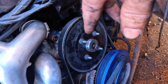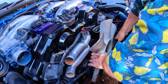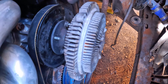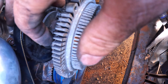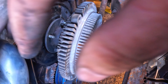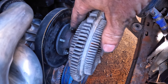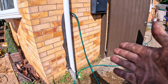Now I'll loosen up these 10mm bolts and refit the viscous fan. The best way to do this is with the fan off the pulley initially, because the water pump has a centre spigot that needs to line up and under belt tension the pulley tries to flex, causing the belt to fall off the back. So with the fan off, get one bolt in first to hold it flush, then get the opposite one in, then top and bottom, then put the fan back on. I've also put the boost hoses back on.